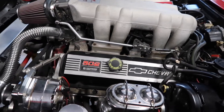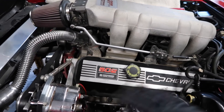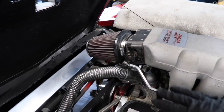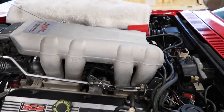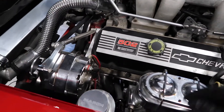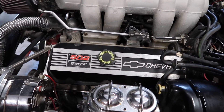The first thing I'm going to do is label each spark plug wire and pull all those off, then pull out every single spark plug. After that, I'll open up the throttle plate, disconnect the distributor, and probably pull the fuse on the fuel pump too — just so when we crank it, we're not dumping fuel or causing any sparks. That way we get consistent cranking for each cylinder.